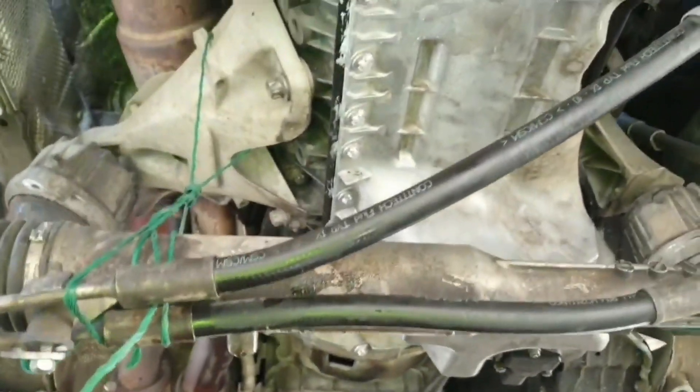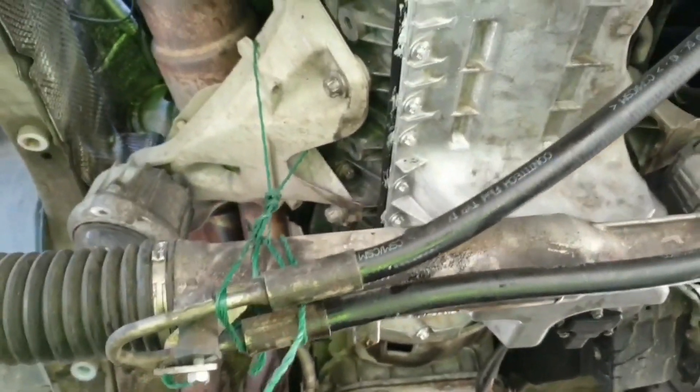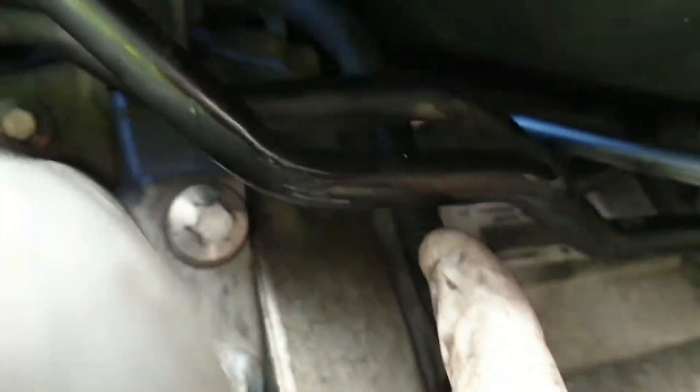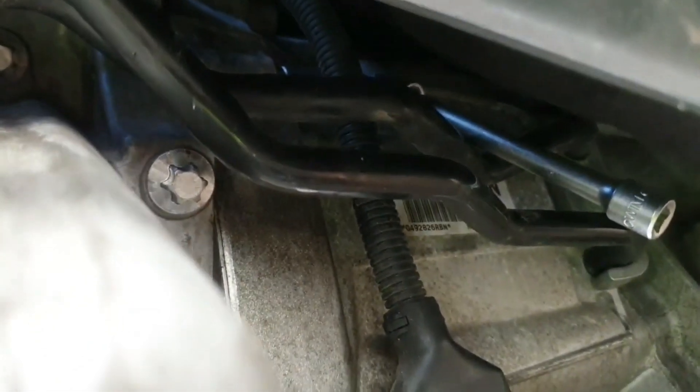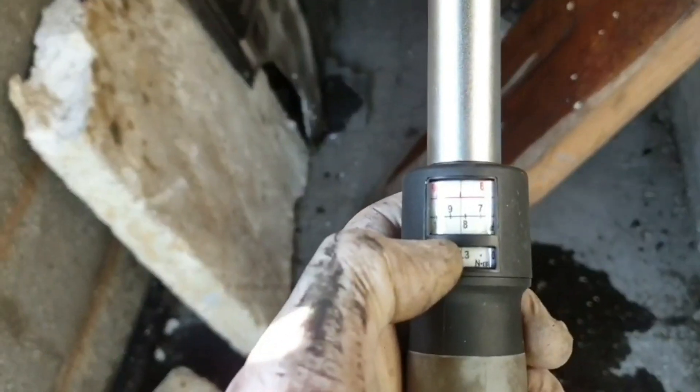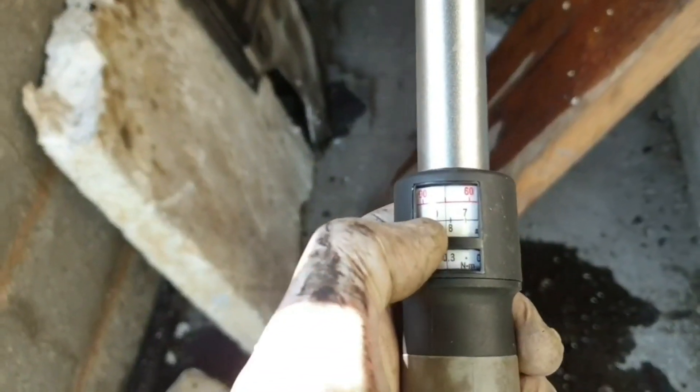It's finally in — I've tightened everything. This bracket goes in here with one hole, another one, and the third one right up in there. This bolts the oil pan gasket to the automatic transmission and it's very tight. Normally you can lower the engine a little bit, but I managed to do it with a swivel head 8mm socket. You have to torque it to 8 Newton meters — I tightened it to 8.3 Newton meters.